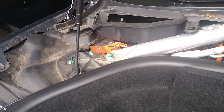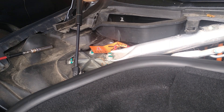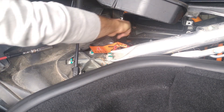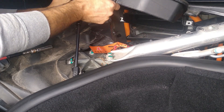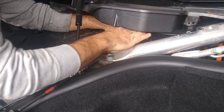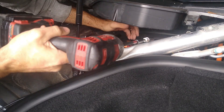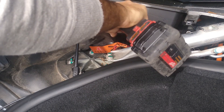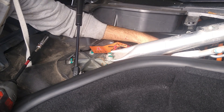Next step is to pull out the fireman's loop and disconnect the 12 volt. I went through the process of taking off the trim pieces, then we took out the filter and took off the filter casing by unscrewing it. That gives us access to the 12 volt battery — all I really need to do is disconnect the negative. So let's do the fireman's loop first — right here. There it is, that's disconnected. And then disconnect the 12 volts. Pull that off, and there she is.